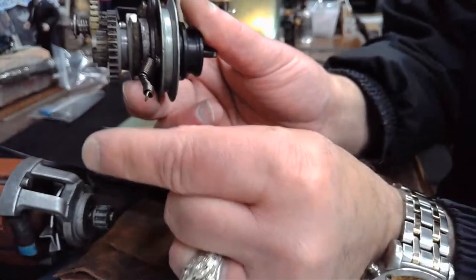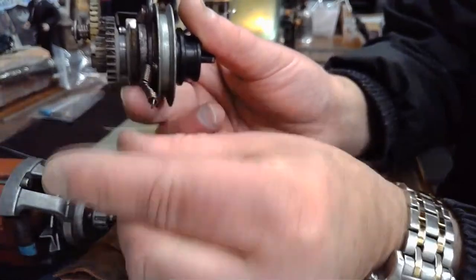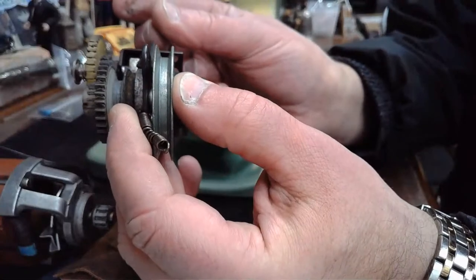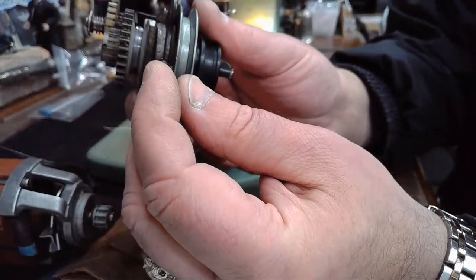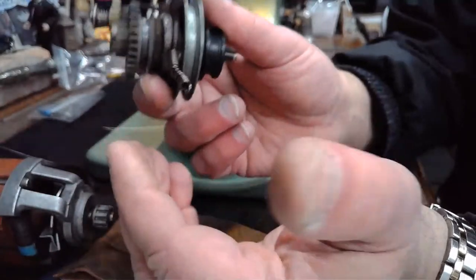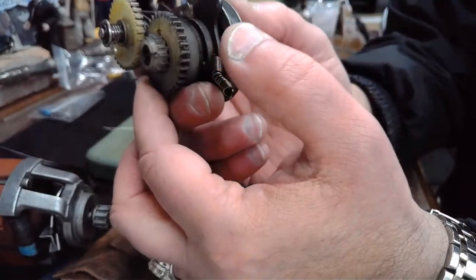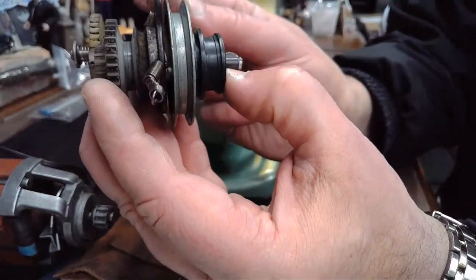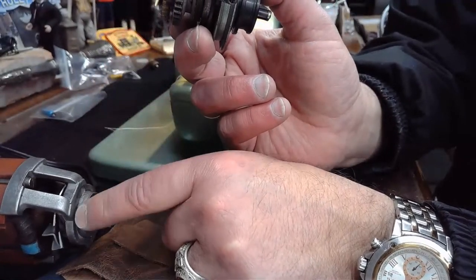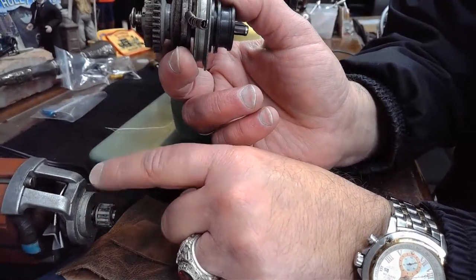Attaches to a little lever that's mounted to the case, the inside body of the case of the machine, and you can adjust it up or down to create more tension that will tighten up the belt. That's what this spring is for. And a lot of folks will just leave it kind of free hanging. I've gotten a lot of Swedish Beauties in the workshop where it's not connected, but that will help you as well to create a little bit more horizontal tension on that belt to try to compensate for the failure of that rubber boot. But again, you're going to have to do something about that rubber boot, because otherwise what's going